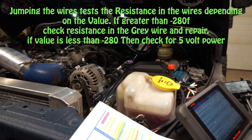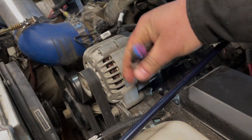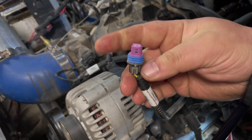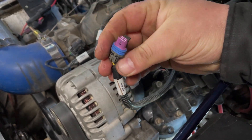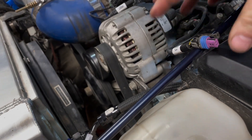To keep this quick and dirty: the yellow wire is going to be my 5-volt reference, and the other wire — which could be gray or tan — will be my sensor ground. I'm going to put my jumpers in there.